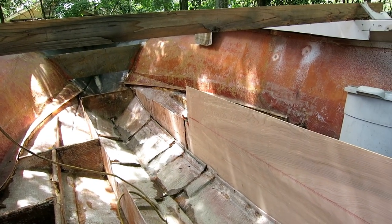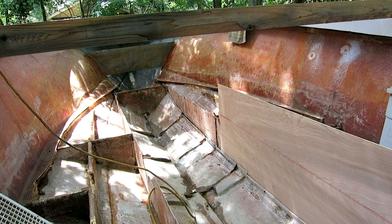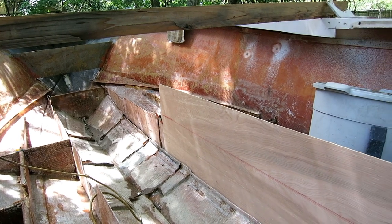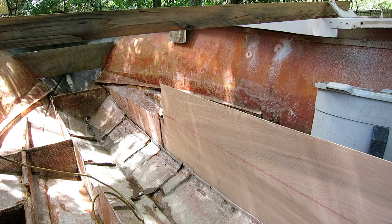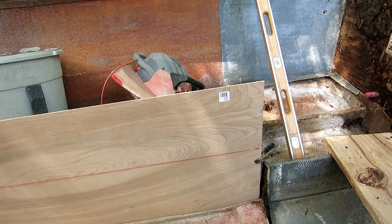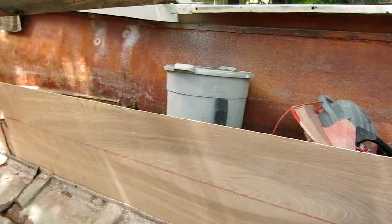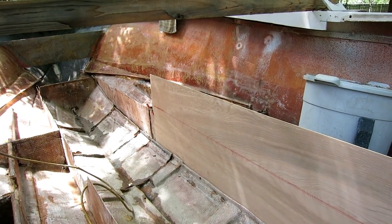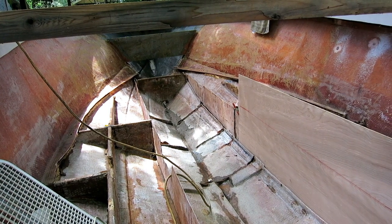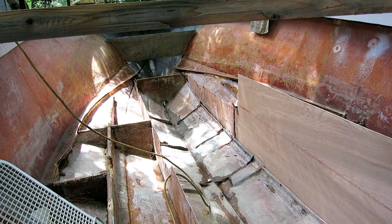My plan is to make the stringers the height of the old floor, maybe kick the front up a little bit. The new floor will be about three-quarters of an inch above the top of the stringer if I use three-quarter material. This is a tough decision because once I make it I'm done. I think the stringer in the back will be as high as the original floor, making the new floor about an inch higher, and up front I'll pick the chalk line up maybe a quarter to a half inch, which projected all the way to the front will make the floor up there maybe two inches higher than in the back.